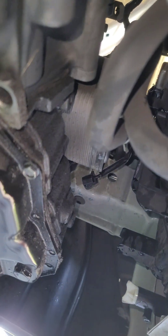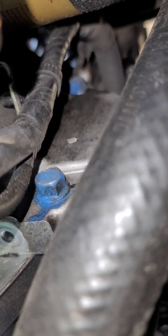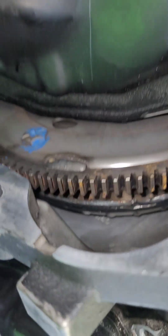That's going to be tight — I might have to remove the radiator hose to get to those, especially the one up top. Torque converter bolts first, then I'll put the transmission jack under here. I have to have something to hold up the engine as well — I might put the cherry picker on it, that way it's out of the way from the bottom and just helps lift up on it.